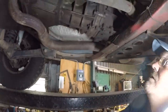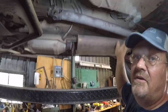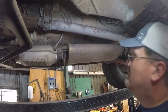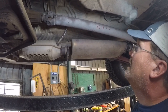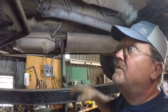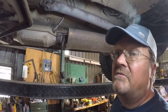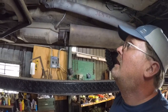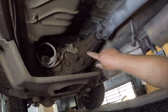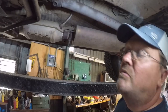In the rear, this is all the factory ZJ stuff. The rear drive shaft measured from center cap to center cap is 36 and 1/8 inches. That works perfectly with basically stock suspension and stock slip yoke. If you're going to do a slip yoke eliminator or similar, you'll have other issues and will need to figure out that drive shaft separately. The transfer case is a 231 — the one out of the factory ZJ manual transmission — though 231s are pretty common.